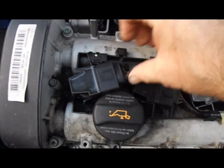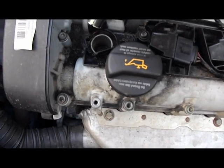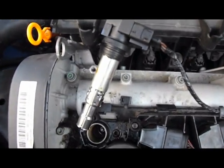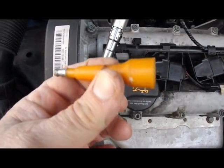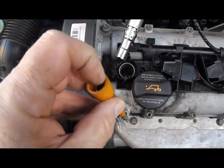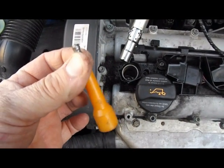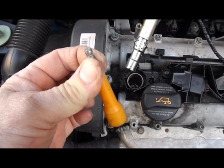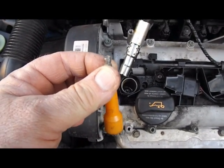There's the coil pack — just lift it out. What I'm going to do now is put in my spark plug tester. Really cheap, three or four pounds at the auto shop. Spark plug goes in one end, lead in the other end, and it will flash if there's a spark. That helps you pinpoint whether it's a spark plug or lead playing up. I'm going to plug that in and start her up.